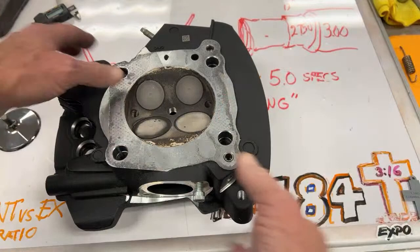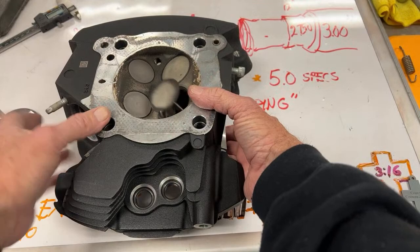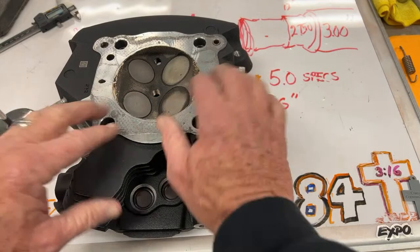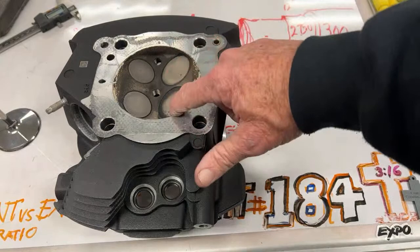By the way, y'all, this is a Hemi. It's a four-valve Hemi. The valves are running toward the intake, the intake runs towards the exhaust. If you open this exhaust valve and leave it open too long, and you open this intake valve too soon, these valves could hit each other. But they're very far apart. They're very far apart this way. It's stock. But look how close they are to the chamber. You can't put a bigger valve in here without running into the chamber.